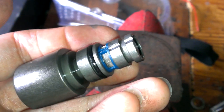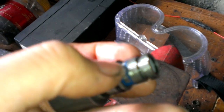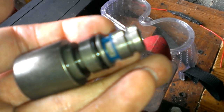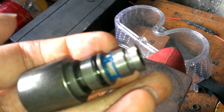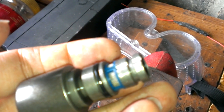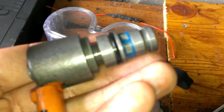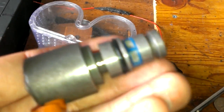And you want to leave that O-ring off, so it pretty much bypasses the PWM solenoid — it's not regulated anymore. So whenever the transmission locks up, it'll lock up right then and there instead of slipping into the lock up, like what this solenoid makes it do. It makes it so you pretty much don't even feel it shifting or locking up.